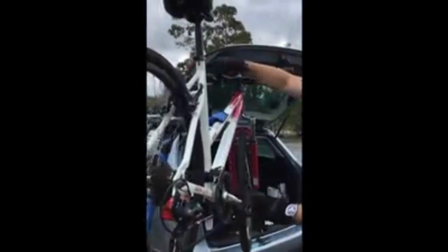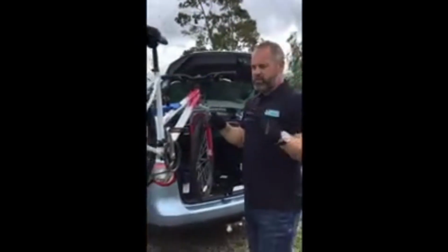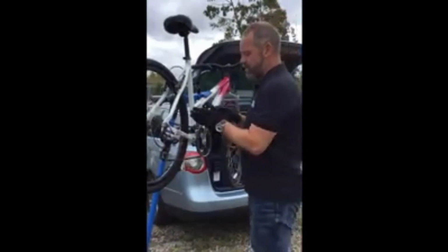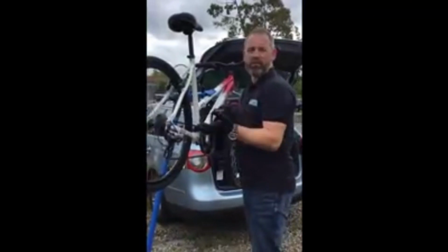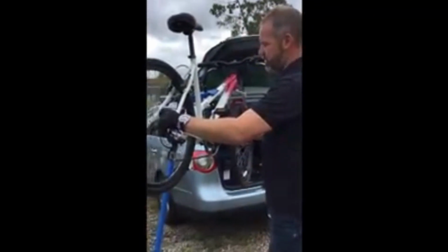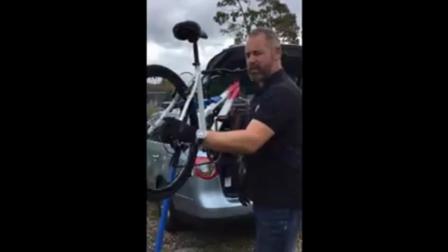And have we got enough to go up the gears? So there, we're in the big gear. The longest the chain ever needs to be is when we're in the two big gears, which isn't a great gear to use, but to be honest, because you're on such an extreme angle, you wear your drivetrain out very quickly. So I would always say, if you do find yourself using the big gear and a big gear up here, maybe drop down to the middle gear and a little bit further down the block.